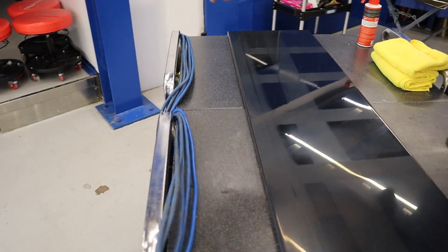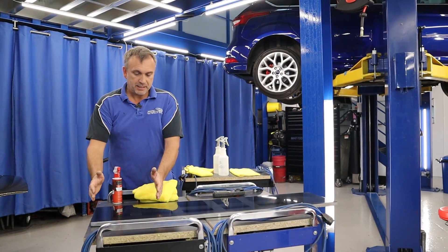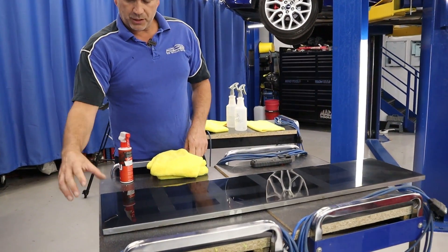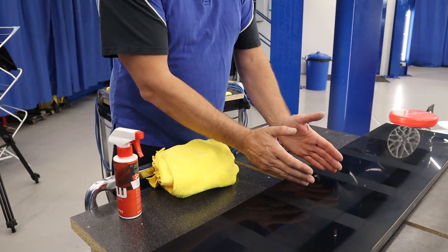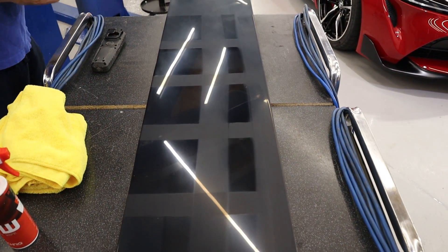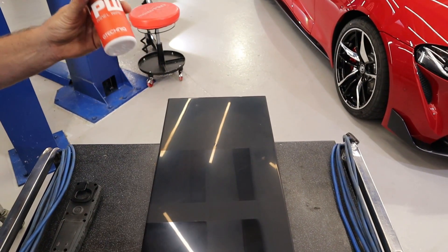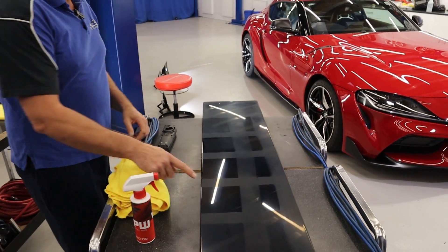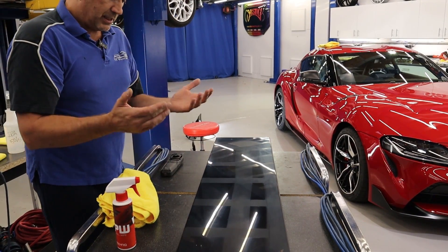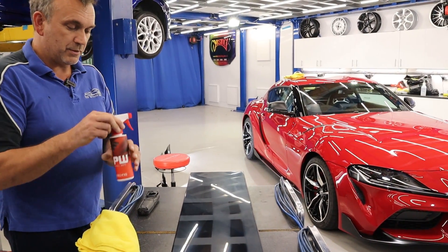Now they are pretty much exactly the same as the control strip. What does that tell us? That all of these patches and squares — none of them have done any real correction. None at all. They're all just make-up. The amount of people polishing their cars and leaving them looking shiny only for them to be dull a week later — detailers are also caught in this; they're only 50% correcting, 50% filling. For full correction, we use G-Technics panel wipe all the way through the process to evaluate our work. And you wouldn't want to put nano coatings on an oily, slippery surface — it won't bond. You want a squeaky-clean, dry surface so the coatings bond.